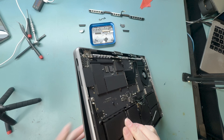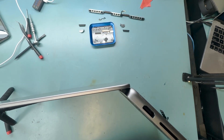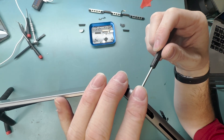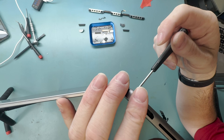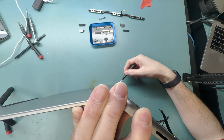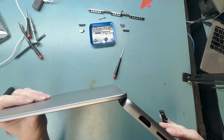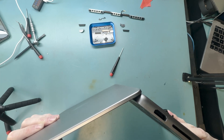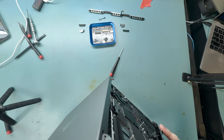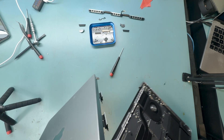Open it up, put it on its side — there's still a remaining screw to unscrew while it's tipped on its side. Hold it up at an angle, unscrew it, and hold the screen with your hand. Since the screen is already broken, don't worry too much. Once that's off, lift the screen up and slide it down to remove it. It's a little difficult but once you do it once, you'll know how.